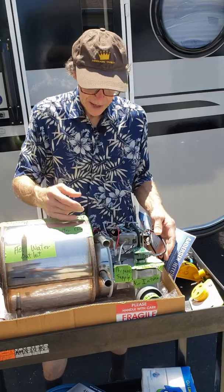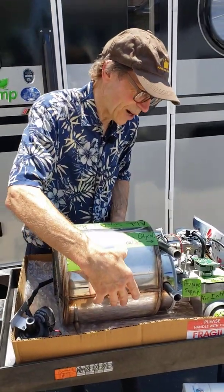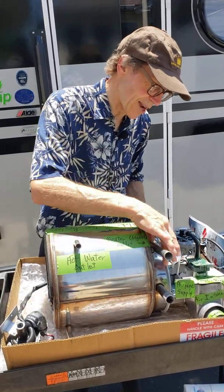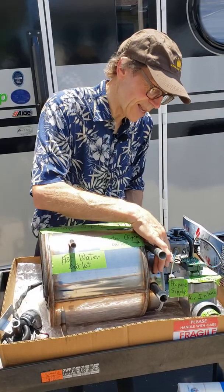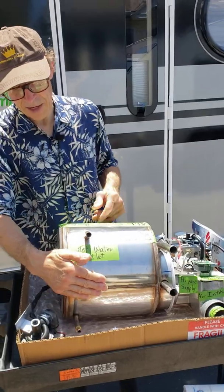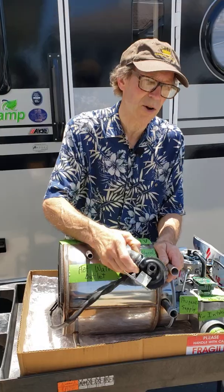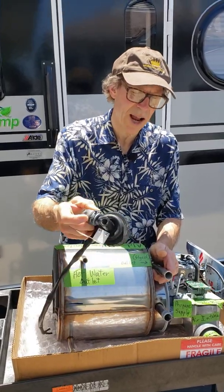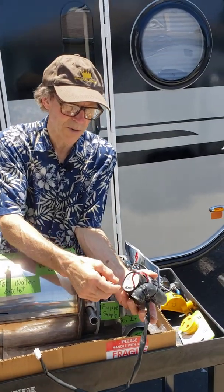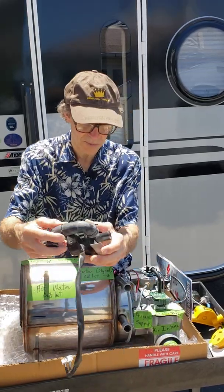Besides that, you have the wraparound hot water tank where water is heated by conduction. So your glycol tank has the heated glycol from either electric or propane, and you've got this tank wrapped around it. And the circulator pump operates to move the glycol around to the radiators, and it works silently. There is an adjustment on here. For bigger systems, they would need more flow. On this one, they turn it all the way down and then up, maybe a quarter turn at most.